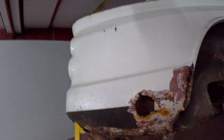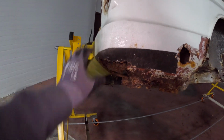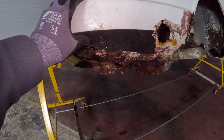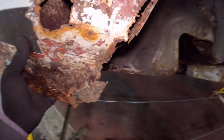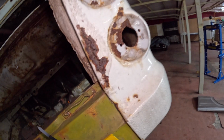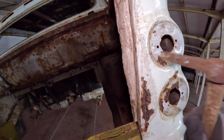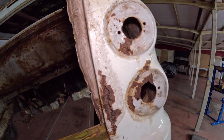Now, these back corners are actually available on their own. You can actually buy a full section down here, all the way around to the back at the back transom panel, and the fit is absolutely fantastic. So it's perfectly possible to replace this whole section, but you will normally find, right, look at the back, that some inner damage is also present. As is, wait for it, my favourite section in the world to repair. Backlights. Again, shiny paint covers it.